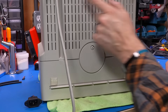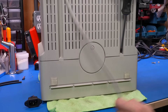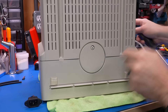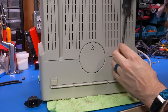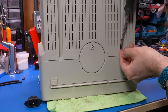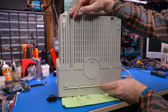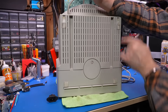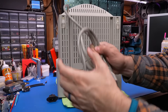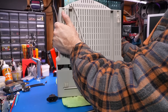Removing the cover — looks like I stuck some rubber feet on here, they must have been missing. There's normally a little support bar that sits on the bottom edge to give the monitor a little pivot, and there's also a round disc here — I'm not sure what that is, maybe Apple had designed a tilt-swivel stand that was never sold or implemented. One of the other annoying things about the fixed cord is that taking the top cover off you have to feed the cable through it, which is mega annoying for someone who likes to work on their monitors.